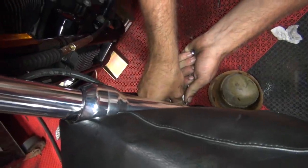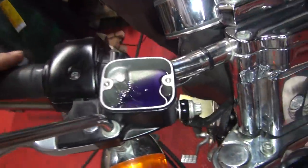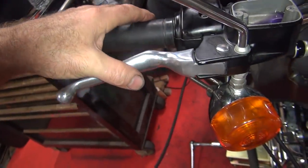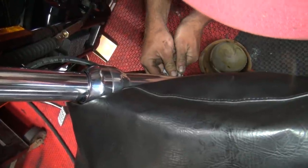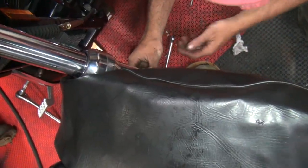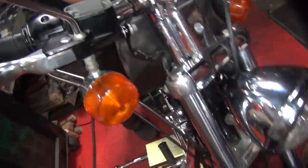Okay, so let's pull out air on the top. Do it again. Now fluid — tighten it down a little bit. Is it tight? Yes. Okay, so now I can release. Now we're getting fluid coming out. Yeah, that's because the fluid finally got to it. Now I'll watch the lever — it's almost full. Okay, go about half of the fluid, and if you need any air let me know. Tighten it up. No air. And I want it with about half a pedal — just fluid on that one. Tighten it up for real now. That's good and tight. Should I put the cap back on? Yeah. Wipe it all down and put the cap back on it.